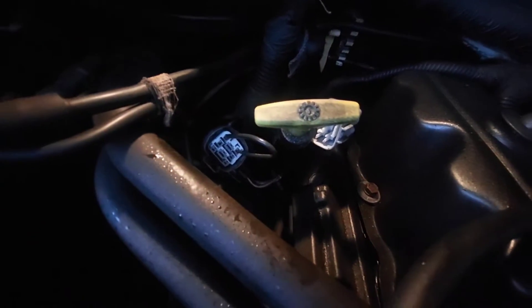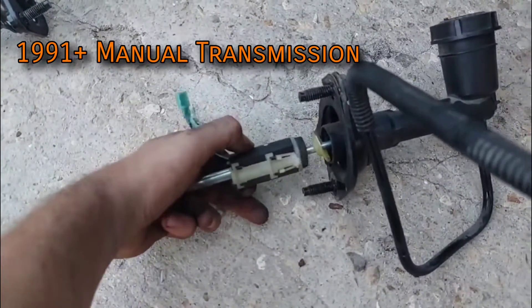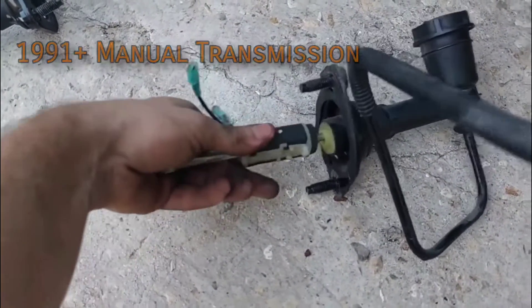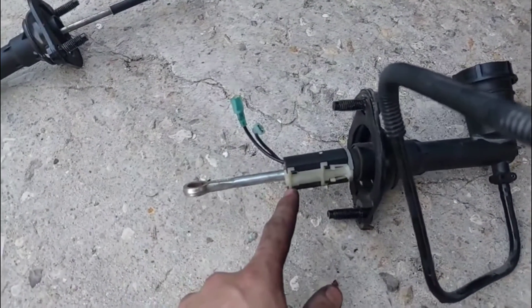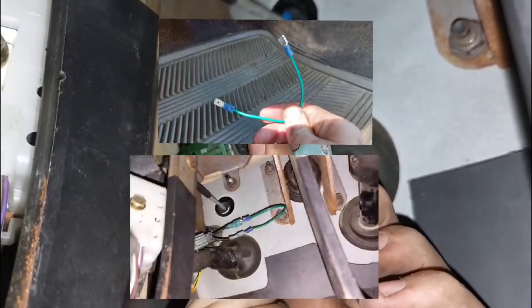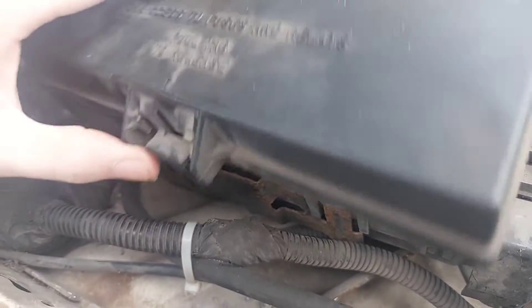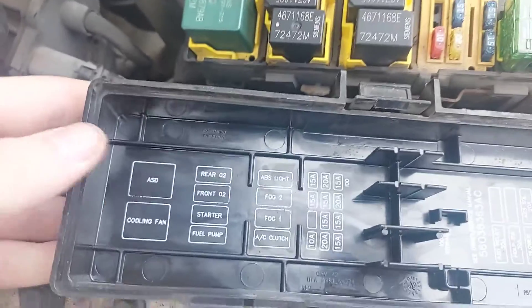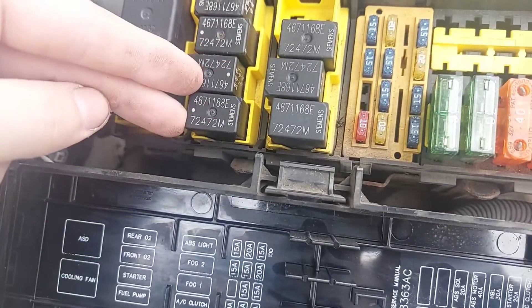Just make sure to plug this connector back in before driving anywhere, because the check engine light might come on. If you have a manual, starting in 1991 they instead have a clutch safety switch, or CSS. It does the same thing as the NSS but mounts to the clutch pedal, only allowing the engine to start if the clutch is pressed in. You can bypass these by just connecting the two prongs together. But if the Jeep still doesn't start, the next check would be the starter relay — on the OBD2 Jeeps you can swap it with a different one, though that resulted in no change, so the only thing left is the starter.